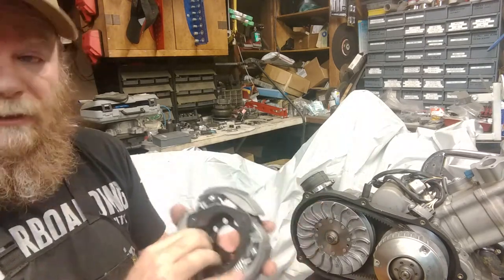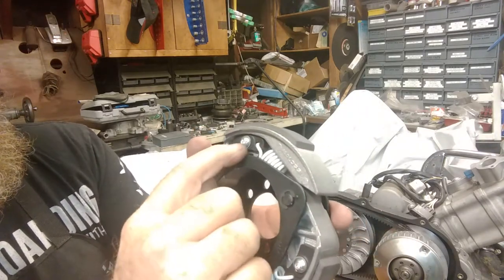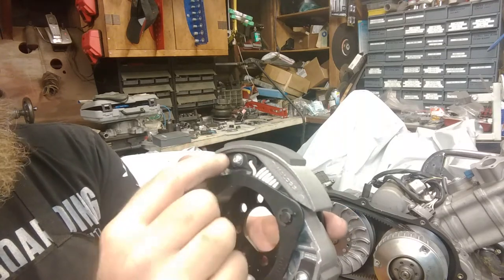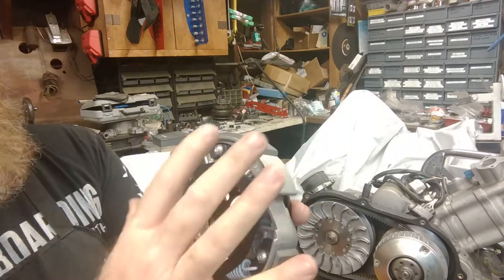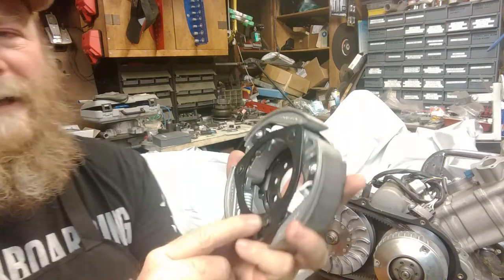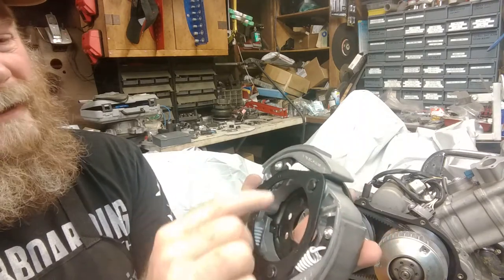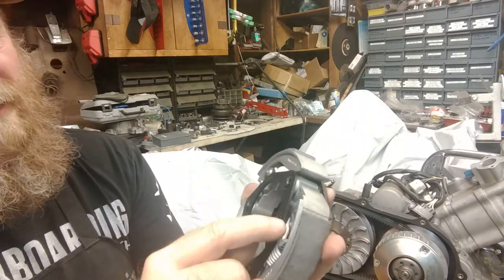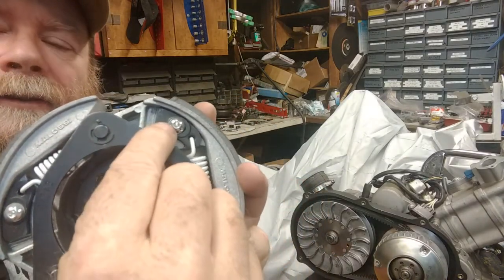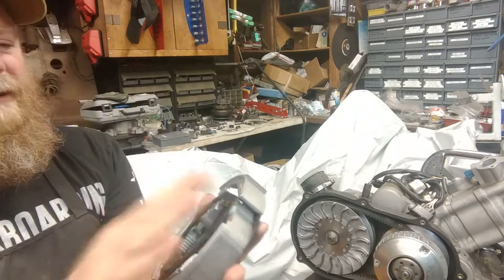This system right here is called the Delta Clutch. The crazy thing about the Delta Clutch is that you can loosen it up and change where the spring setting goes into these little ridges. So you can make the spring looser or tighter — it'll engage how fast it bites, whether at a low RPM or higher RPM. To do that, you basically take these three circlips off — do not lose them — take this little ring off, pop this off, and you'll be able to loosen it. You can go forward or back about nine steps total, then put it all back together.